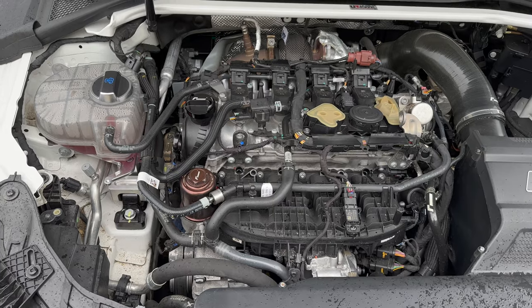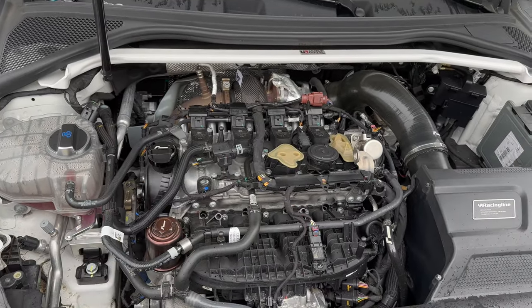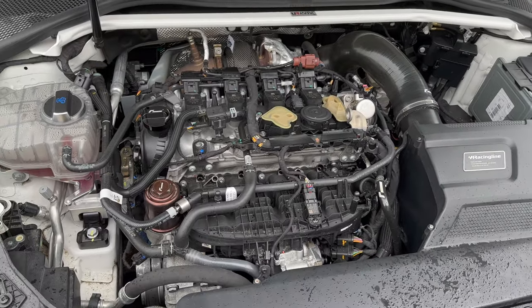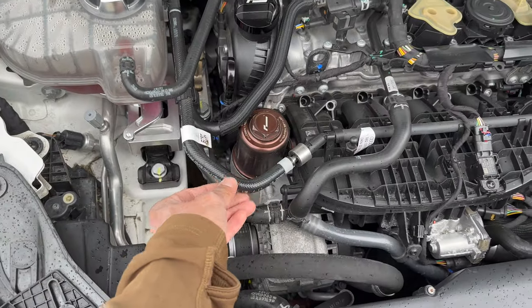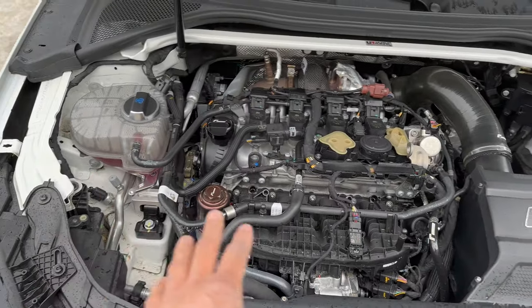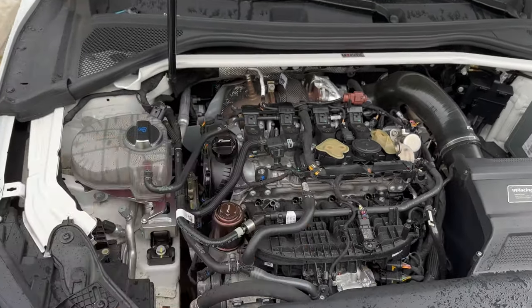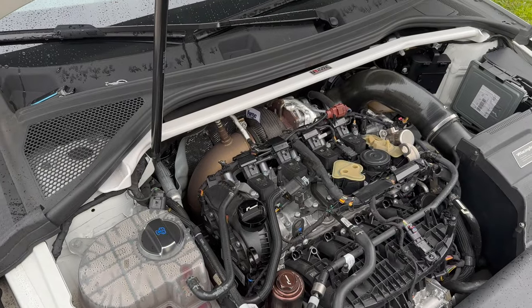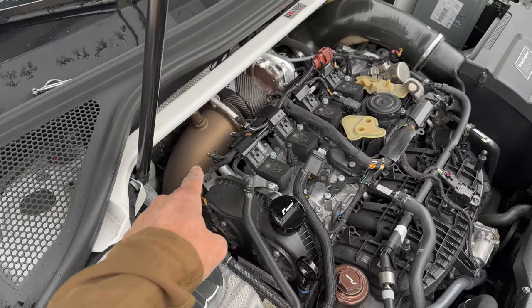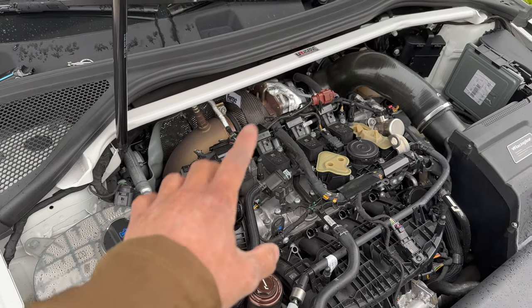I kind of wish this would either get more of that color or get a brand new one, even though it's going to change color — I've had this for many years. That's what happens to anodized parts: they turn that color with heat over time. I have a really strong vision of how I want this engine bay to look — probably a nice Galano billet manifold, fuel rail sensor, braided PTFE line with some white or bronze in it. Cerakoting that pipe significantly reduced heat — you can touch the pipe literally two minutes after the car shuts down and hold your hand there. But get even near the turbo and it burns your hand. It's crazy how much that thing does.